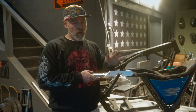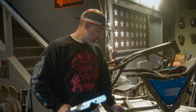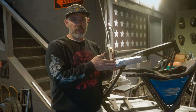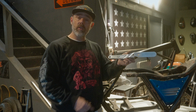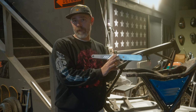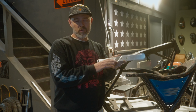Another thing to remember, on the RS fitment, your convertible bags, your leather pros, they all fit on this, no problem. As you guys may or may not know, with RP or RT clamshells or police bags, you have to run RP, RT struts. You cannot run those with these struts, because this 45-degree angle won't let the factory bag mount sit flush against it. You can still run leather pros or convertible bags on the upright shock position RP, RT strut, but the factory clamshells or whatever won't work. I have seen them modified to work, so if you're handy like that and you want to do that, by all means, go for it. But just a disclaimer, your factory police bags won't fit on these struts.